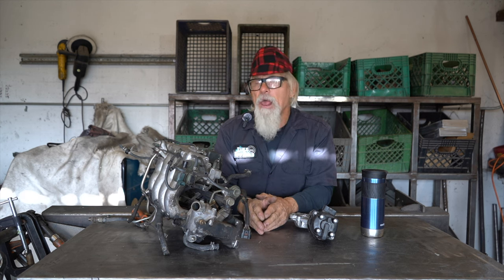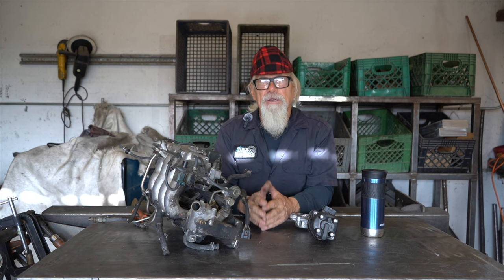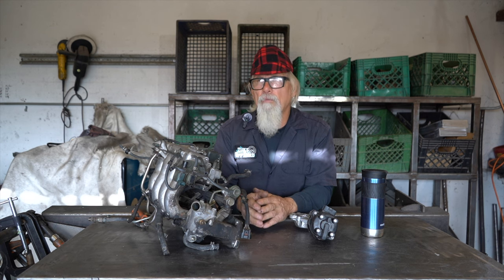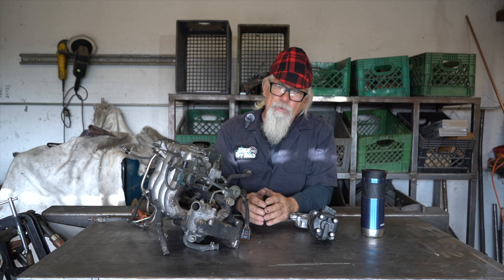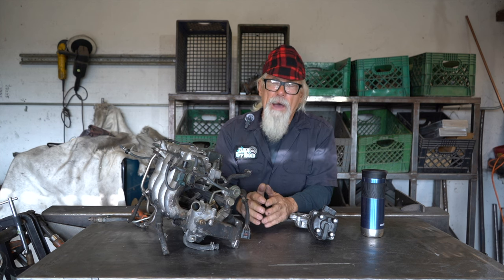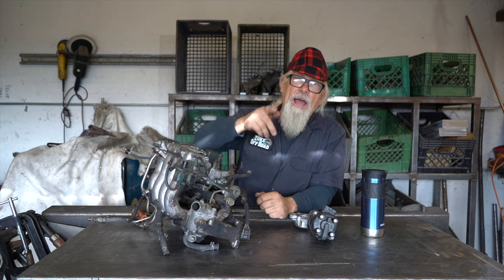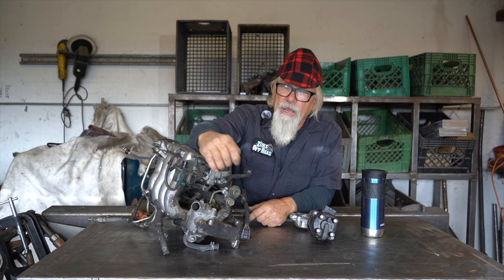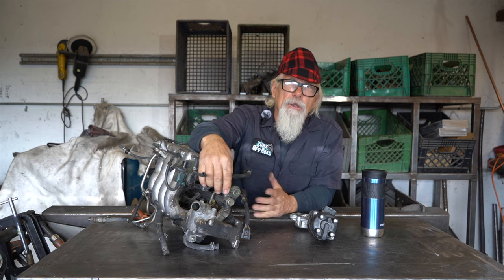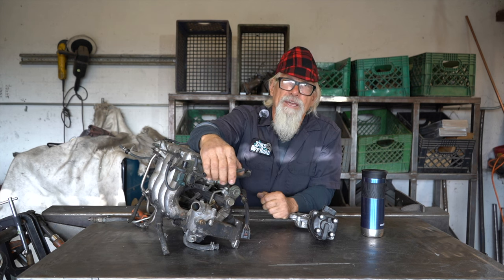Complete wipe-out of the rings from overfueling. It's very simple - you should be doing this once a week. You should be checking the coolant, and you should pop that hood, check the coolant, and check the pressure regulator. How you do that: just start the engine, pull off the vacuum line, and if fuel is shooting out of there, you know you have to replace it. It's super easy to replace.